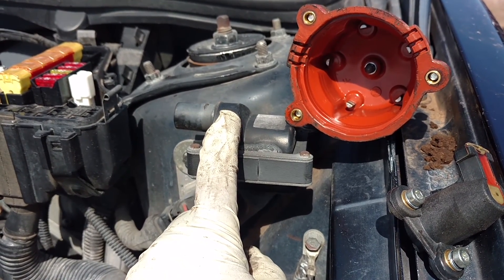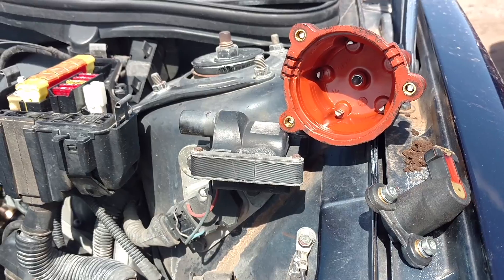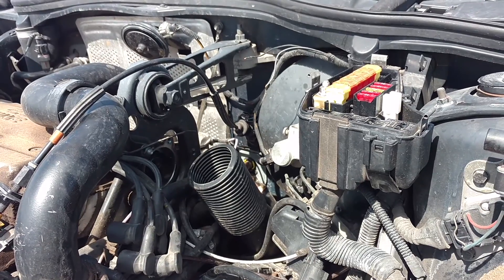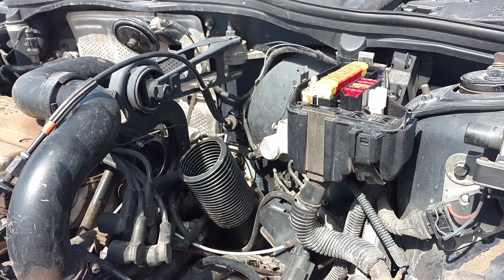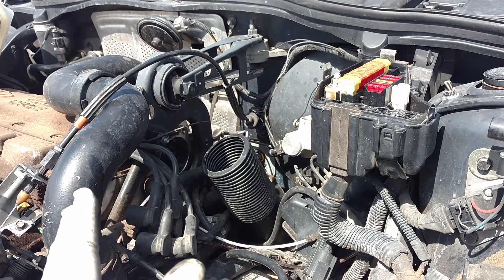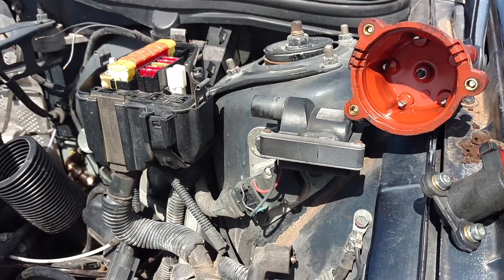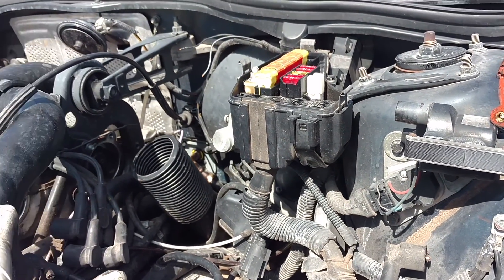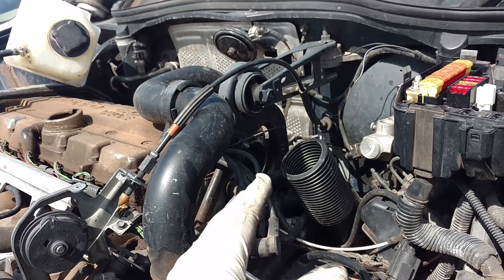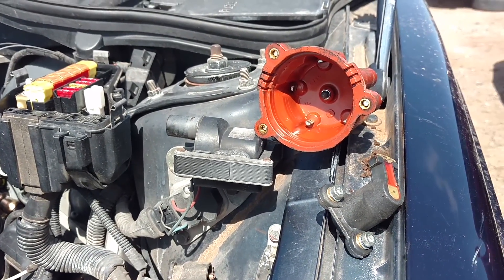Your newer cars that don't have a single coil here instead have a coil over each spark plug. Each coil has the job of discharging that spark only to that one spark plug. That reduces the duty cycle of each coil because you've got five individual coils instead of one coil servicing five plugs — that's an advantage in terms of coil longevity. Also, each coil is dealing with only one plug, so it won't wear out as fast.